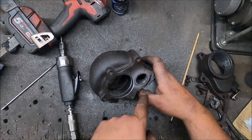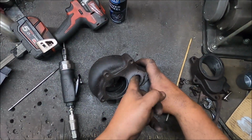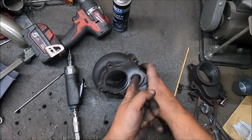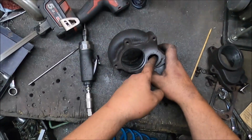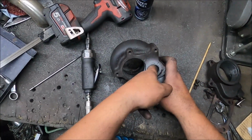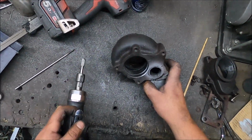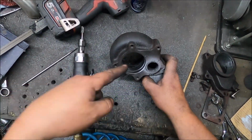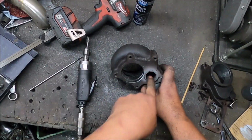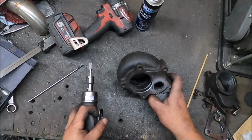I said about the short side, I did realise it'd be so good a little bit, and I have absolutely massively improved that, so I'm going to do a bit more. I think that itself, I can do it there as well, and probably there, is going to improve things more than enlarging the gate. Honestly, this is fucking massive. There's a lot of shit to get rid of there. You can probably see it, I hope. I don't know how good the light is from the camera, but by my eyes you can see, whereas it once was a straight drilled hole, there's now a, you know, centimetre or so where it's closer. So I'm going to keep going.